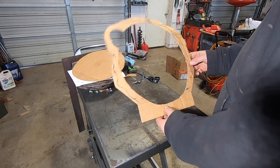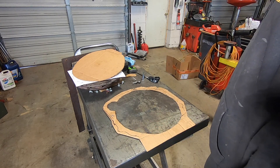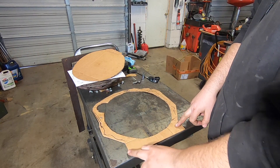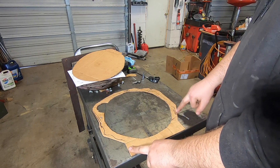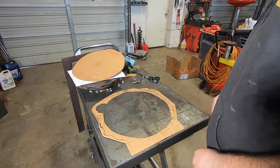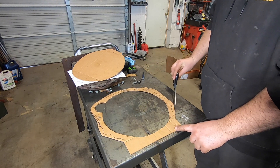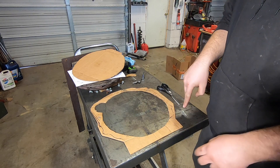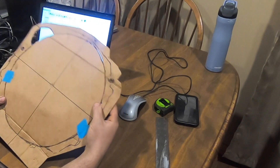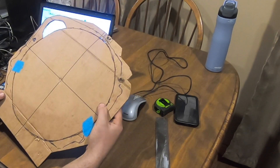That's the design — pretty simple, does what it needs to on the engine side and the Subaru side. I just need this to be an inch and an eighth thick, probably aluminum. I'm thinking about leaving this really beefy along the bottom — maybe even up here a little — because some midship motor mounts would be really easy to bolt onto this plate, and that's literally the strongest part of the drivetrain assembly. Final revision: I'm going to leave this meat here to give me area where I can drill, tap, and bolt motor mounts to mount it in the buggy. Now I'll put this into the computer, draw up a couple different designs, get quotes to have them made, and see if I can make it myself.